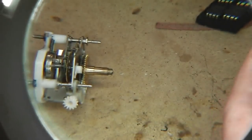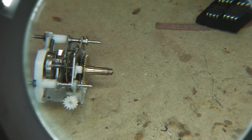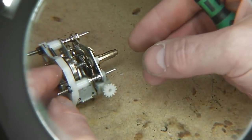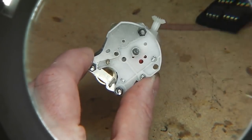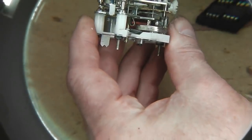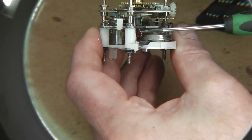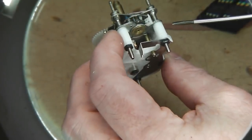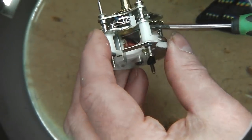But all in all, we've done some good investigation with the clock, and we could now leave it running and start to trim the time in. As I say, I don't know which way is fast forward on the clock and rewind, although you may be able to reverse engineer how they've done it. Looking at the clock adjusting shaft, this is it here, goes into the workings. If you look, you can see a brass rod coming in, which is the end of the screw, and it touches a sort of P-clip shape piece of metal, which must, I just can't quite work out how it's doing it by rotating that. It's obviously doing something to advance the time or delay the time.